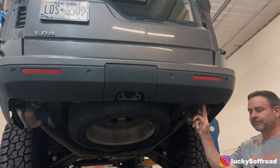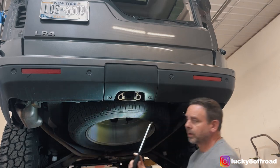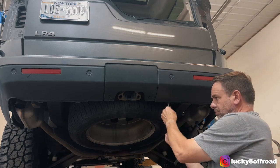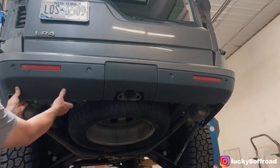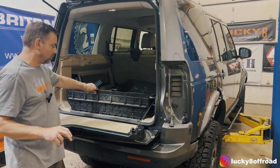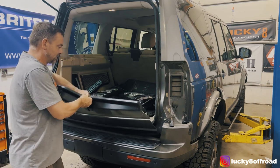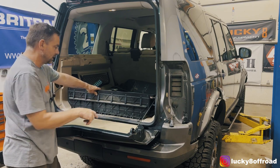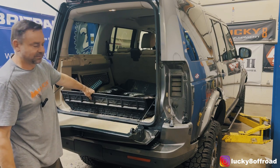And there's a bunch of Phillips screws underneath we're going to want to pull off. On the underside, there are four Phillips screws — one, two, three, four. We're going to want to get those loose. We are almost ready to remove the bumper cover. There are a few more plastic clips we need to get to. We need to balance this little flappy piece and the tailgate to access those clips. Just for the sake of the video, I'm going to pop this off and make it easy for everybody to see.